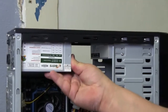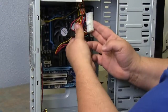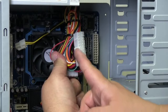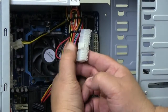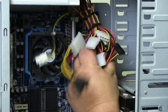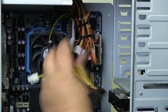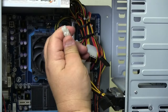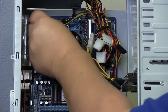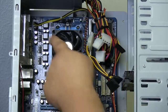Now your power supply is in snug. Let's plug in the 24-pin power connector — there are 24 pins on your system board and 24 on the plug. The squeeze pin is on this side to lock and unlock, and there's a ledge on the edge. Line up your pins with the holes and push until you hear a snap — it's locked into place. For the four-pin power connector: your clip, your ledge — it only goes one way. Line up the holes and push until you hear the clip click.